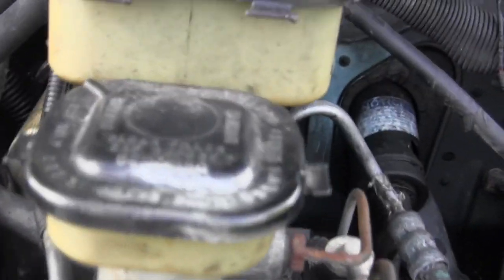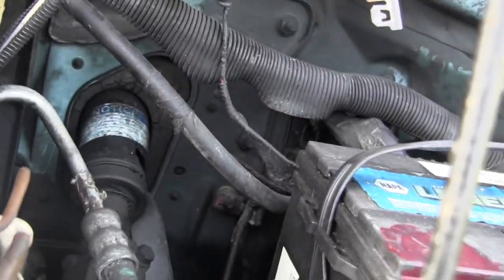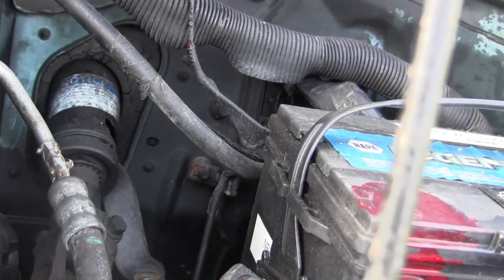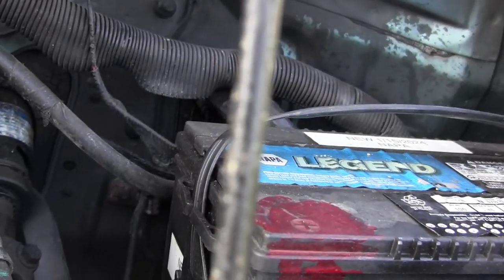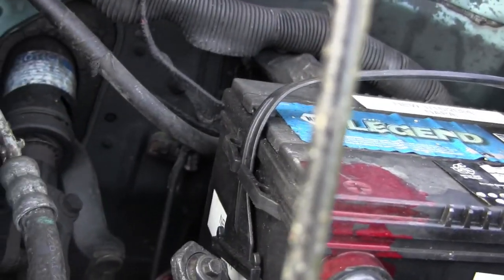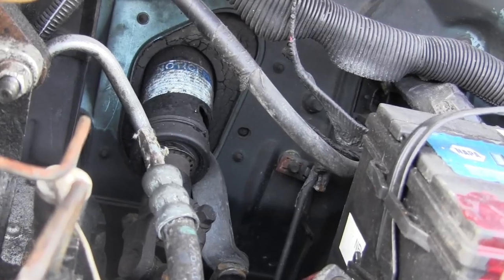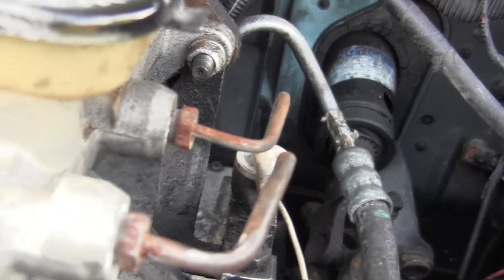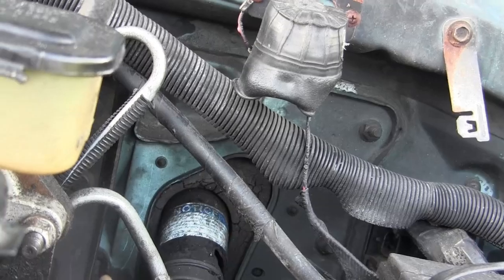So next I'll connect the number 1 spark plug and crawl underneath and crank the engine and see if the starter has the proper alignment, if it's fully engaging, and if it has the right 20 thousandths tolerance, the adjustment on the starter. And I'm not even going to try to start this until, if it starts, it starts, but I'm not trying to start it until I get everything sorted. I don't want to skip steps.